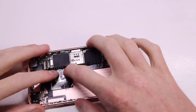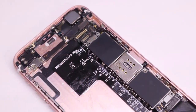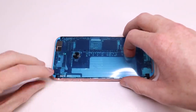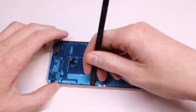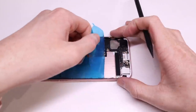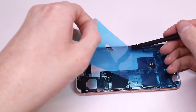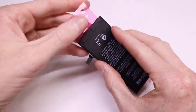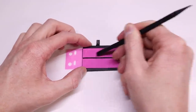Coming back to the phone, I can reinstall the vibrate motor and adhere down the new LED logo into the iPhone. Now that the mod is complete it's time to reinstall everything. I'll need to install the new waterproof and dustproof seal into the iPhone 6s, making sure to apply it correctly to prevent any water or dust from entering the device. Once I seal up the display I like to run a spudger around the outside — this helps the adhesive adhere down to the housing better so when you remove the plastic film the adhesive doesn't come up with it.